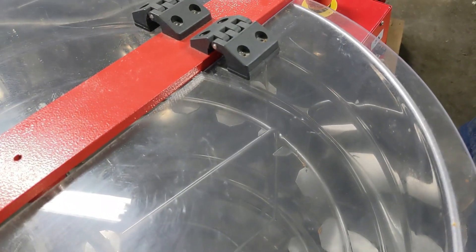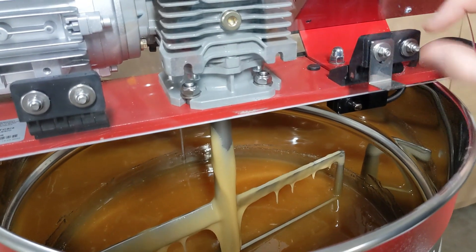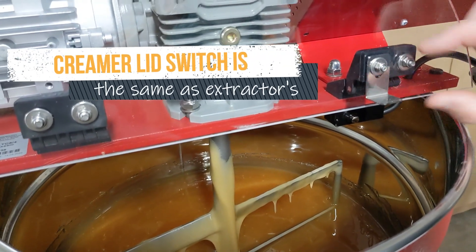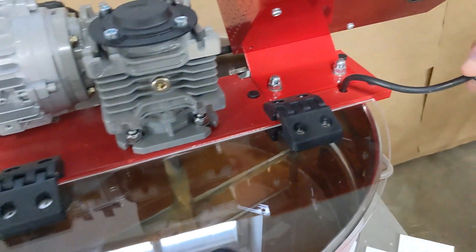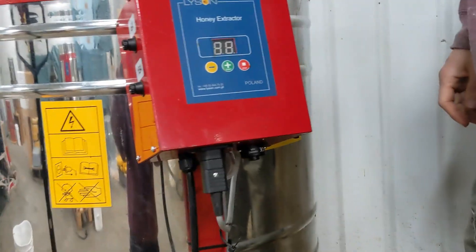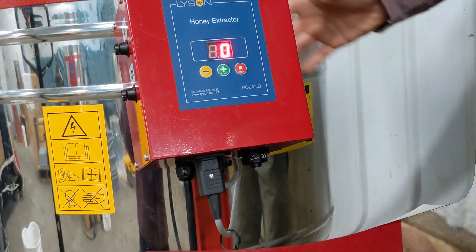Close the lid and make sure that it clicks when it's shut. If it's not clicking even though it's shut, you can adjust the shiny L-shaped connection by unscrewing the screw and moving the L-shaped piece of metal, then re-tightening the screw to make better contact with the switch. Another part of this lid switch is the cord that leads from it to the control box — check that that plug is plugged in tightly.